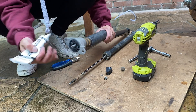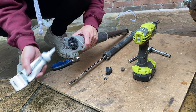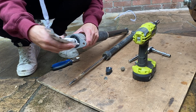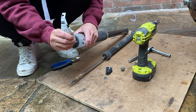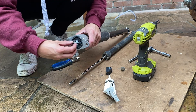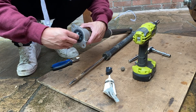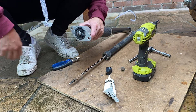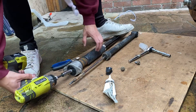Let's move the top mount over to the new shock. I'm going to put some silicone grease on the threads because there's a rubber part on the top mount, and certain types of grease could damage the rubber, so silicone grease is the safe choice to lubricate these threads. I remember when I did the top mount on the other side the nut was quite stiff and the shock was just spinning — kind of like when we did the front shocks when we put the lowering springs on the car at Christmas — that was an absolute nightmare. So just a bit of grease on there and buzz the new one on.